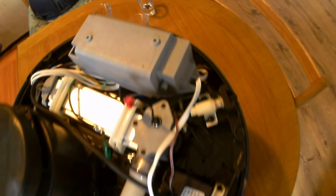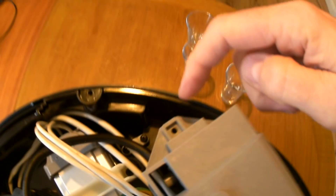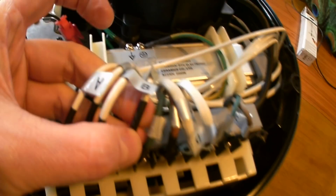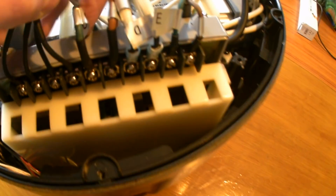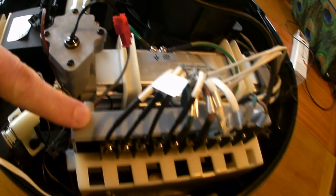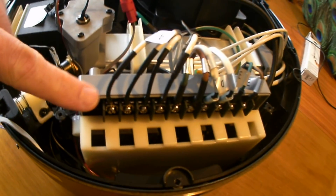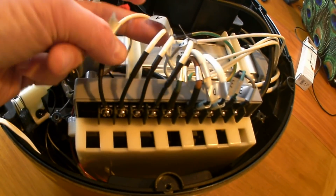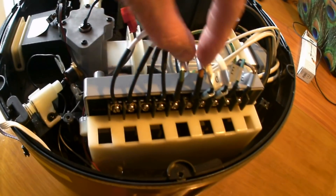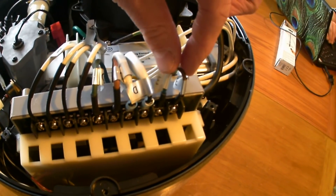Next I'm going to take off the cover here. I've taken the two screws out of this one — that just lifts up, no problem. Now you can see here everything's labelled: A, B, C1, C2, D, E. And on the back here underneath, exactly the same is written. Heater number one are these two, heater number two are these two, power into the device, air pump, and power to the water pump.